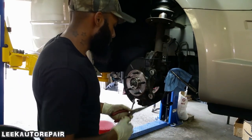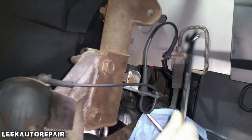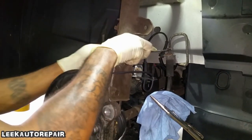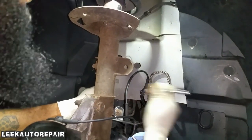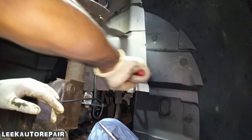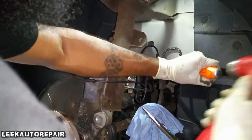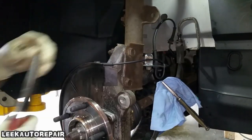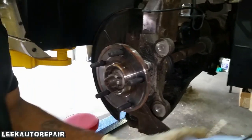If you're only doing one caliper, you only have to bleed one wheel. To remove the brake hose, it's held in by a horseshoe clip — use a pair of needle nose pliers to get it off. But first, while the clip is still in place, go ahead and take this nut off. I was able to get the nut off. Sometimes you really have to muscle it, use two hands. Put that aside, and now I'm ready to take the brake hose out. I don't need the vice grip anymore.